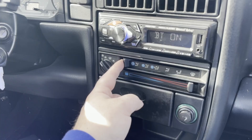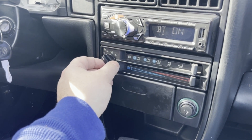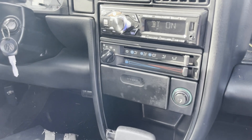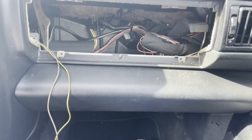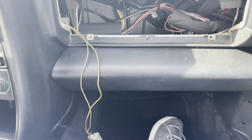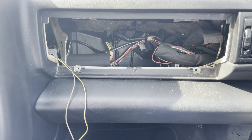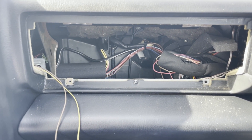For the test with the key in the on position, we're going to go to defrost for instance, and now we should have all four speeds. Two's going — which I didn't have before — three's going higher, and four's going really hard. So that's it. Now I'm just going to pop the glove box back in, which is straightforward — four screws — don't forget about feeding the light through the top hole. And that's how you diagnose and replace your heater blower resistor in a late 80s or early 90s Volkswagen, in particular this 1991 Corrado. If you found this helpful, like the video and please subscribe to this channel.